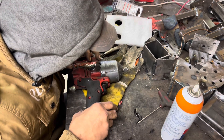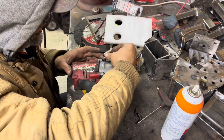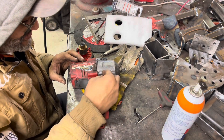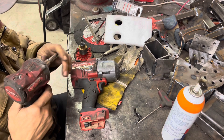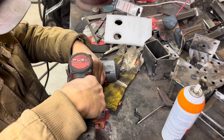Make sure everything is lined up correctly. Give it a little tap. The really long screws go up in here - go ahead and insert them so it doesn't fall apart. There's a short screw that goes here, short screws go here and here, kind of a medium screw goes right there, and then the long screws go right here. The rule of thumb anytime you're working on anything is never tighten anything down until you have all the screws in.